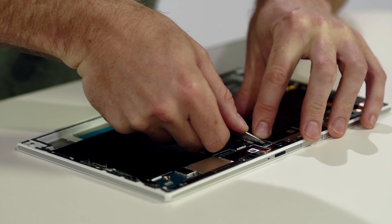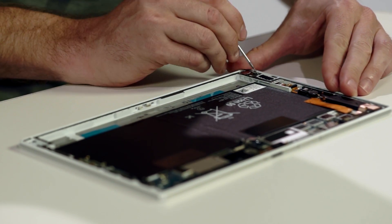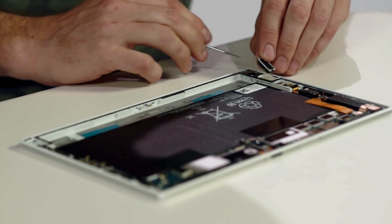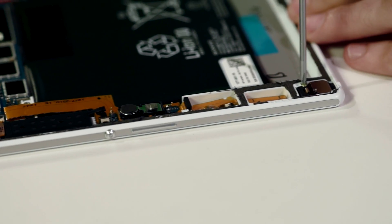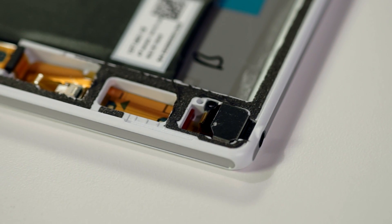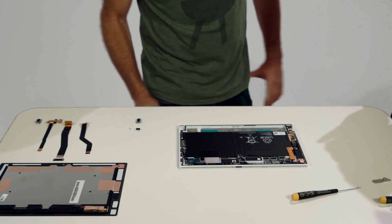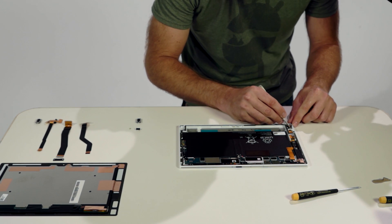Unhinging the battery connectors completes the disconnection of the battery. The left speaker is now removed and onto the 5-pole headset jack. After unconnecting the ZIF and removing the rubber seal, we can see that the headphone jack is in a standalone waterproof housing. This ensures you can plug in your headphones if the tablet was wet without compromising the insides.